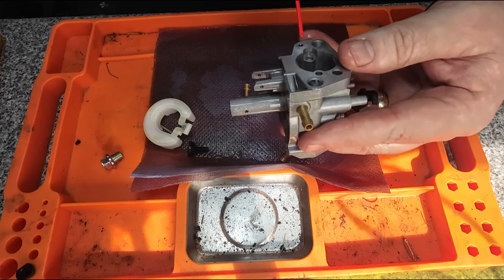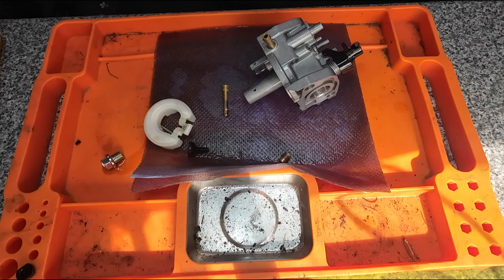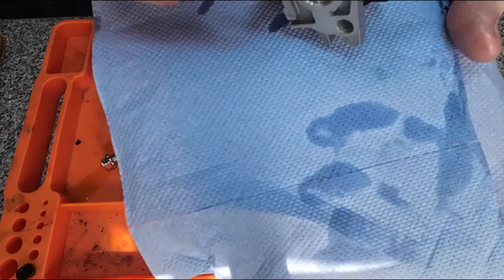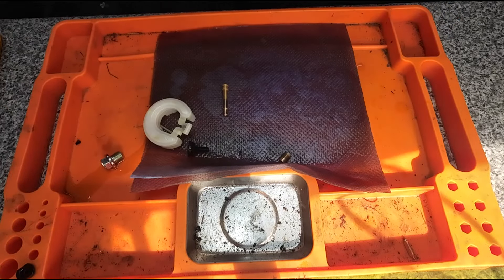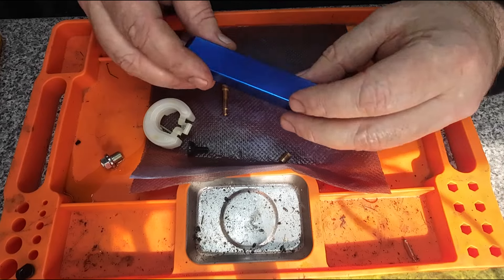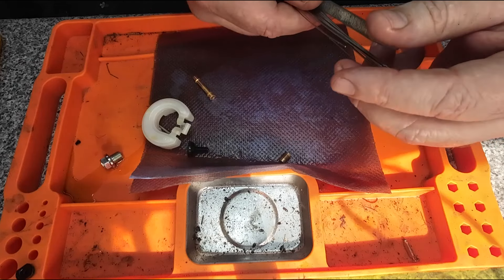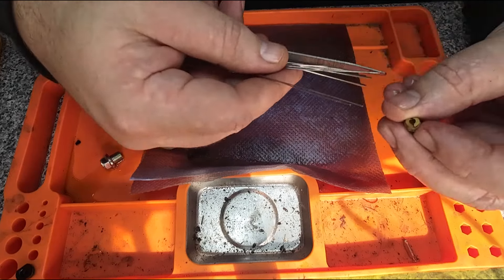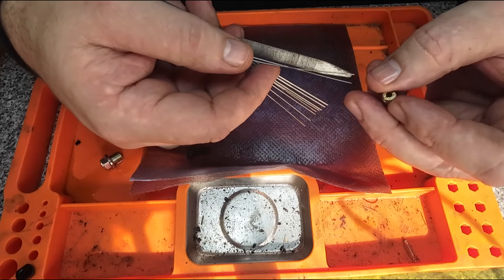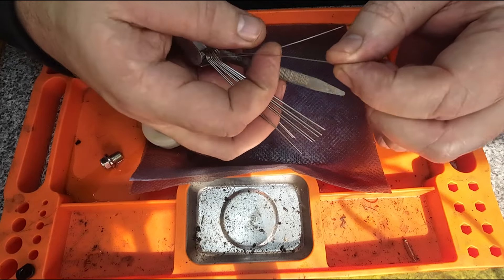A grain of sand will do it — that's why your fuel has to be A1. Once you're happy with the state of your carburettor, get a piece of rag, an old t-shirt, a pair of your wife's old pants — whatever you've got — give it a good shake and wrap that carburettor up so nothing else can get in. The next thing in the arsenal is a pair of gas tip file cleaners — they look just like that, three or four pound off eBay or Amazon. The smallest one will do.